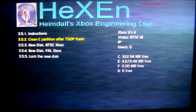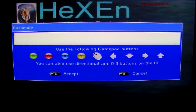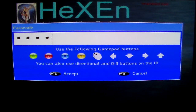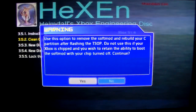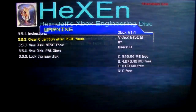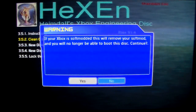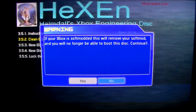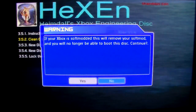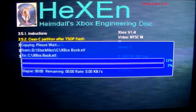It's also going to install some very useful tools that Hexen comes with on the disk — there's a recovery menu, and applications like DVD to Xbox. It will install the Unleash X dashboard back after the soft mod is deleted so you can still use that. You don't have to worry about any of your game saves being deleted or your games being deleted — it just sets you up fresh for a TSOP flash. Very safe. The password is A-Y-B-X and then Start.